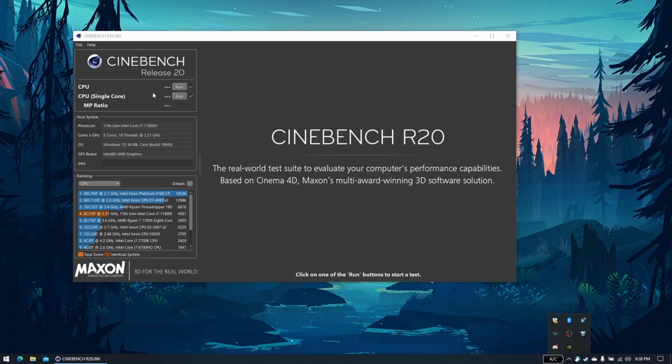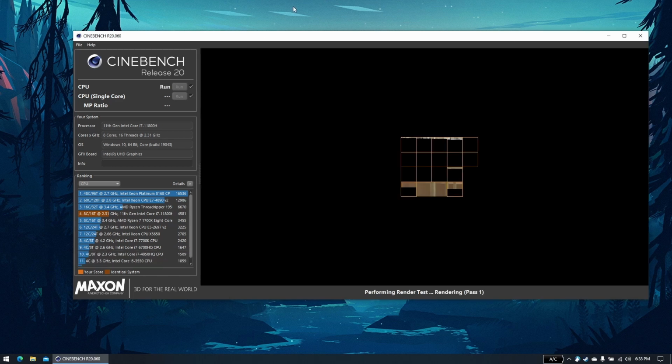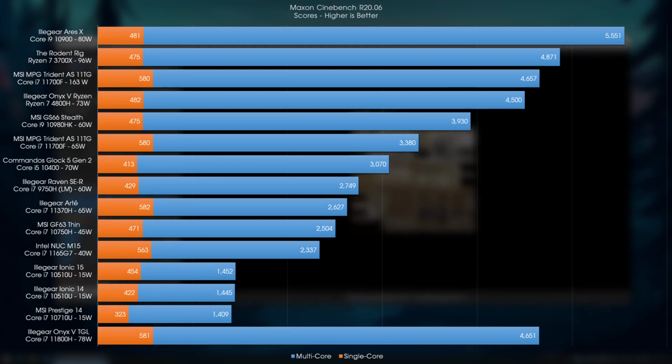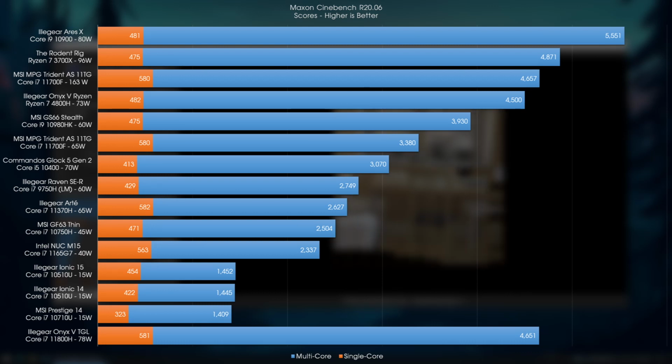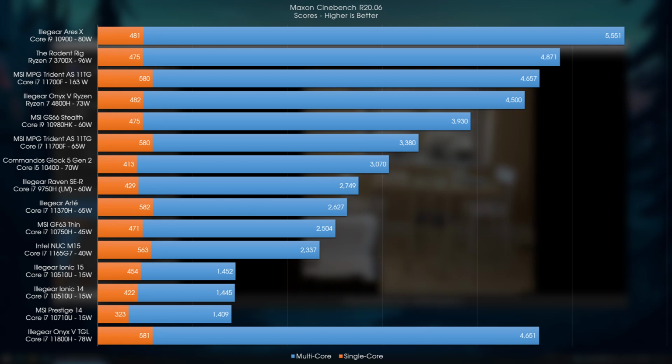Now you're going to probably go online and read that the 11800H has a TDP normally of about 45 watts. Yeah, 45 watts, come on, that's peasant tier, and Illegear knows this too, and that's why the 11800H in this machine runs at an absolute maximum of 165 watts and a sustained wattage of up to 80 watts. Okay, fine. In reality though, it only hits a maximum of about 80 for a short while before settling to about 77, 78, which is still pretty high for an 11800H.